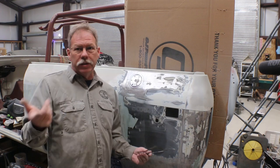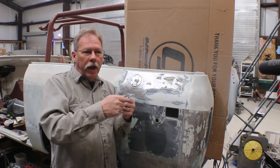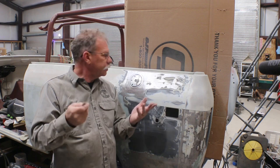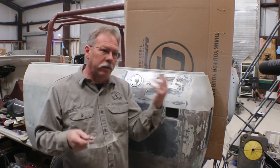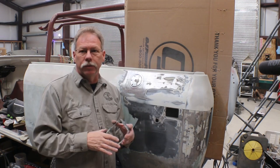The bead roller did just fine. You do have to be very conscious of how you're doing that to keep that hole or that step round. But it worked just fine. And I didn't have to make dies, which would have taken 30, 45 minutes if I even have enough round stock the right size to have done it.